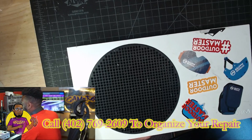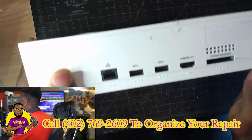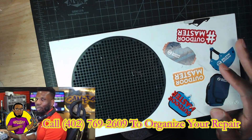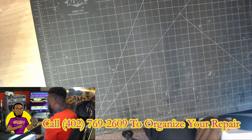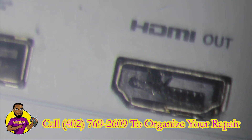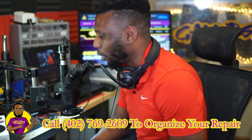Hey, what's going on guys, my name is Dave here with Go Gamers, and today we're going to be taking a look at this Xbox Series S that's having video output issues. So let's go over to the upper cam and see what's going on. As you can tell, we have an Xbox Series S — these things are pretty tiny. The customer brought it in saying it's having video output issues. I can almost guarantee it's definitely the HDMI port, and we can go over to the microscope so you can see the HDMI port is completely burnt out. So what we're going to do is take this apart and replace that HDMI port.